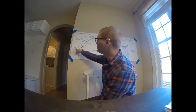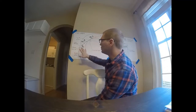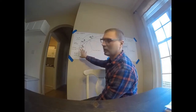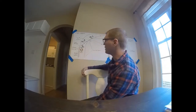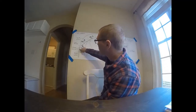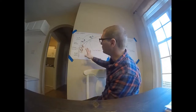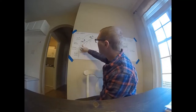So if you can't adjust your Ackerman, think toe out. More toe out, generally speaking, will help with this point in and help the car take a set a little bit better. Okay, that's from turn in to point A, when you plan on really releasing the brakes.